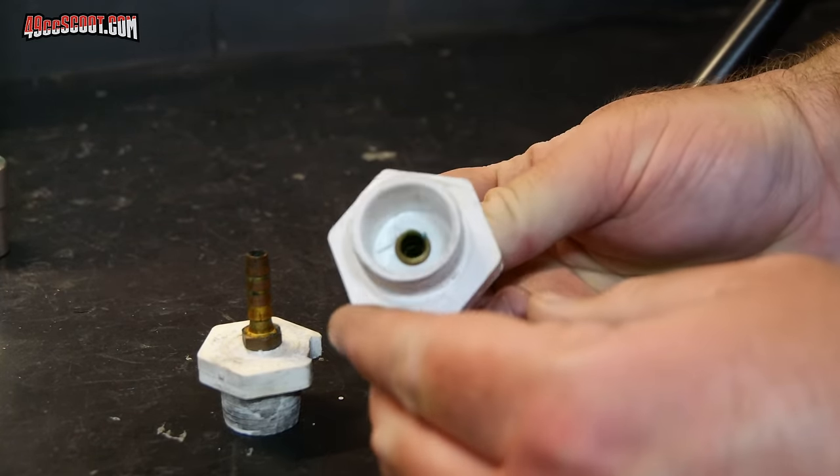What I ended up finding is that I actually have a crack in the engine case — it goes right along here and meets up with that corner of the filler. The case is cracked to the point that it didn't really make sense to try to salvage it. So I'm just replacing the entire case half. I bought another case half from a 90cc ATV — I've already got that filled and ported. Pretty much now I just need to get all this stuff back together.